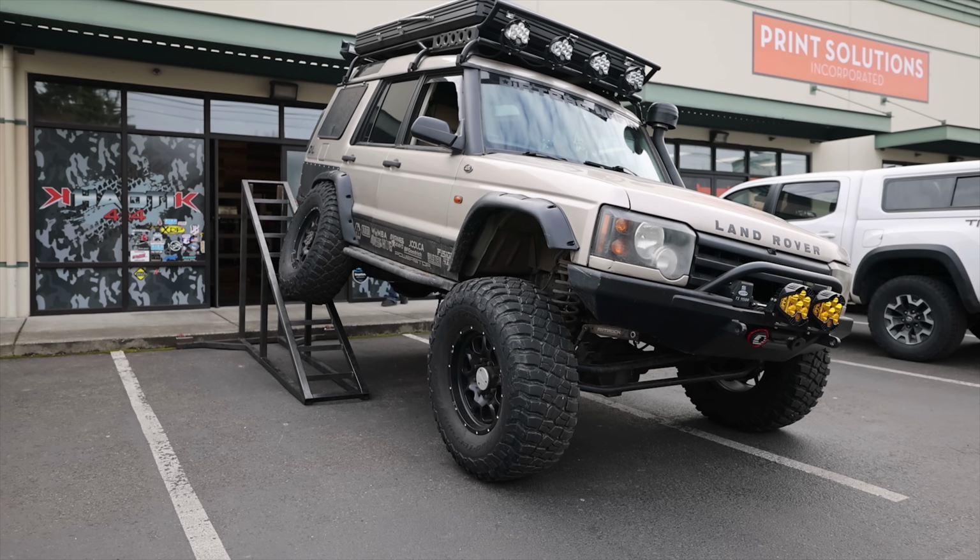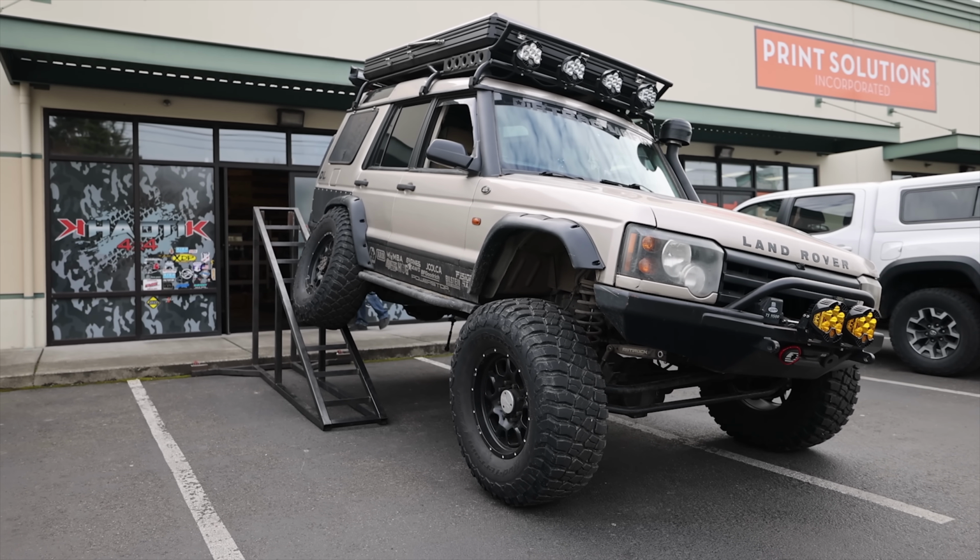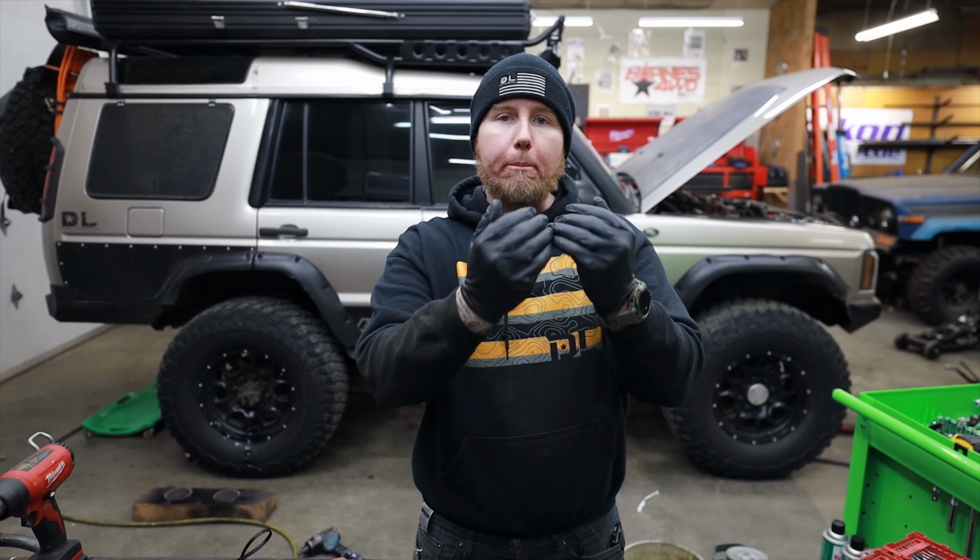One would be to just flex test it. I could use my forklift, because yesterday when I was at Chaotic Fab, we flexed it out, and then after a few minutes of it sitting like that, it started to pool oil out of the top of the housing somewhere, and it was like pouring out of the truss. So that's not good, but it makes it really messy to try to weld it, because we know there's a crack or something in the steel, so we have to weld it.